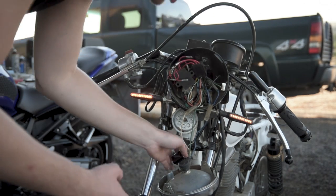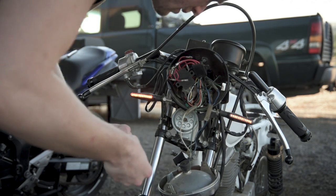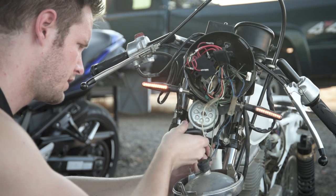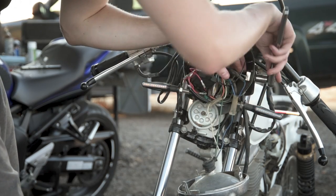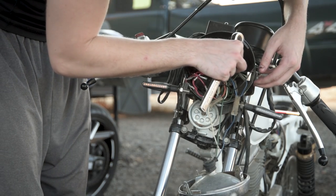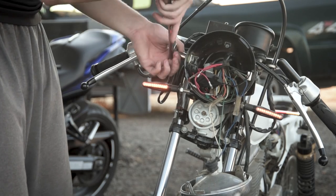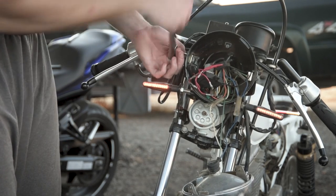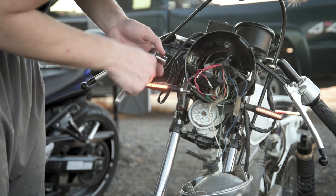I decided I'm going to try making sure the flasher relay is not the problem here. I didn't expect it to do anything, but never hurts to try. It looks like the grounds are good. Let's try the actual turn signal grounds and see if there's a difference. No, it's all the same — the grounds are fine.